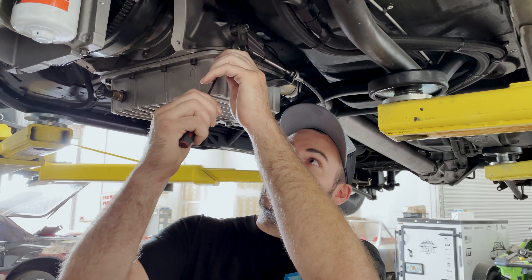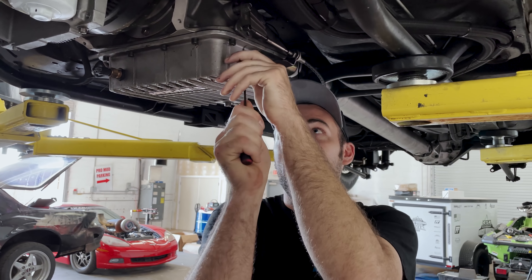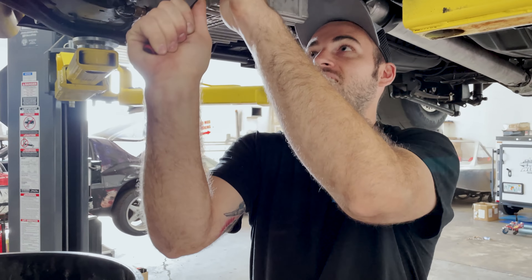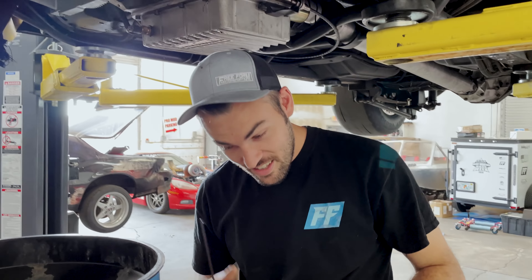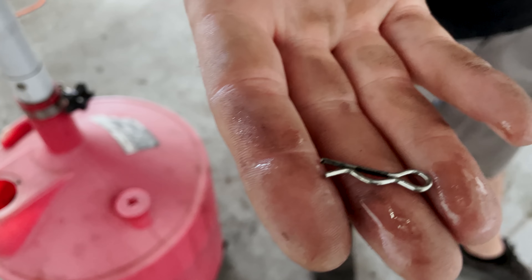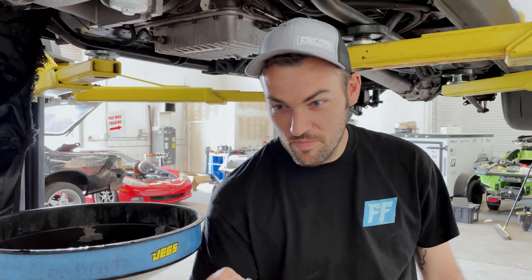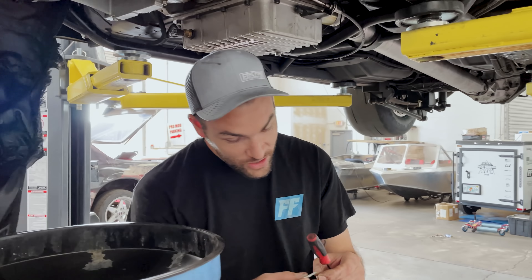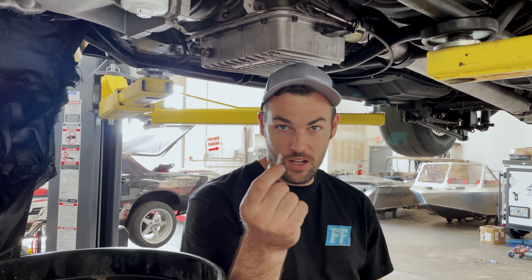I've been doing this gear trick for a few years now and I turned Doug on to it. He's like, this is ingenious, how come I never thought about it? So, this is easily the best thing you can do to your race car because it's going to save you so much time. Right here you have your standard typical RC car body clip. You can buy literally a pack of 10, 20, 25 of these for $10 or less. You keep them in the toolbox. They're reusable, and your wear item to service your transmission becomes a piece of hardware.